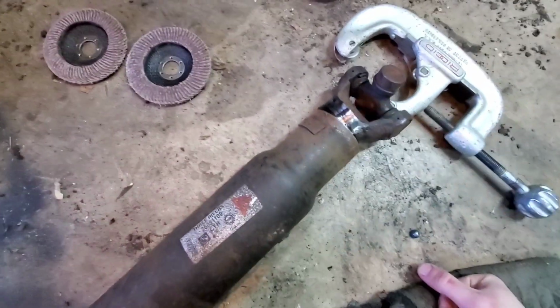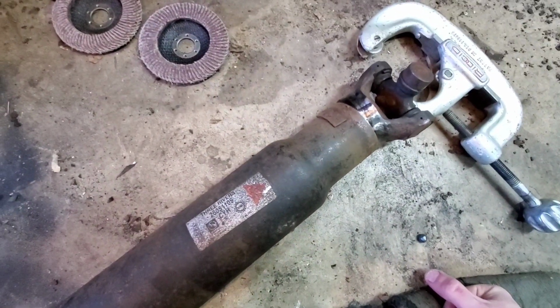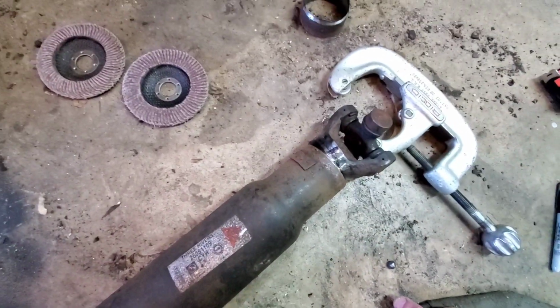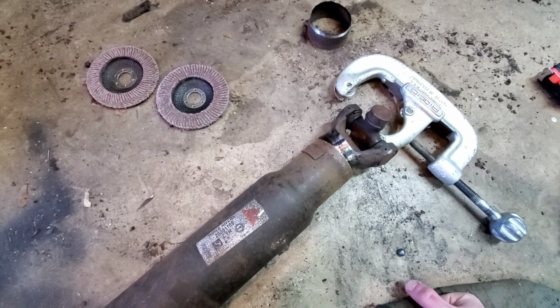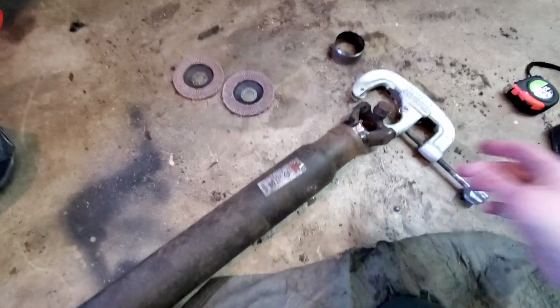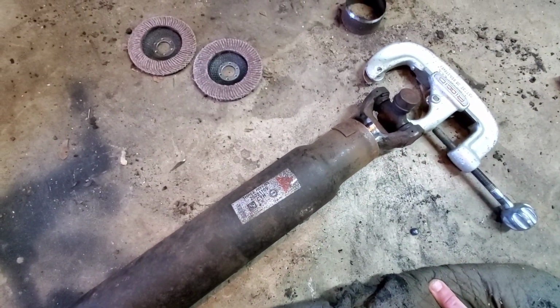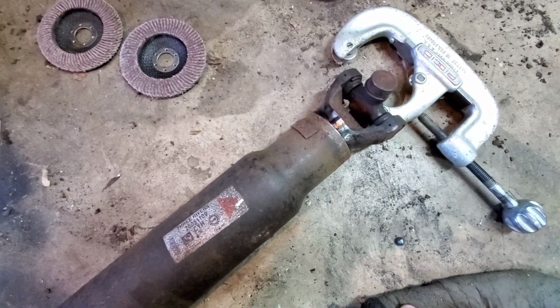And then all I'm going to do is work at slipping that in, making sure my joints are phased properly. I'll tack that in, I'll actually throw it underneath the truck, and then wiggle it back and forth, and I might grab a dial indicator and indicate it and check run out. And once I feel like I have it good as far as run out, I'll jack the back of the truck up. I'll put the mag on the bottom of the bed, and I'll put the indicator on the drive shaft, and then I'll freewheel the back wheels and check for runout, and I can make adjustments on this, left, right, up, down, try to split the difference with it being true.